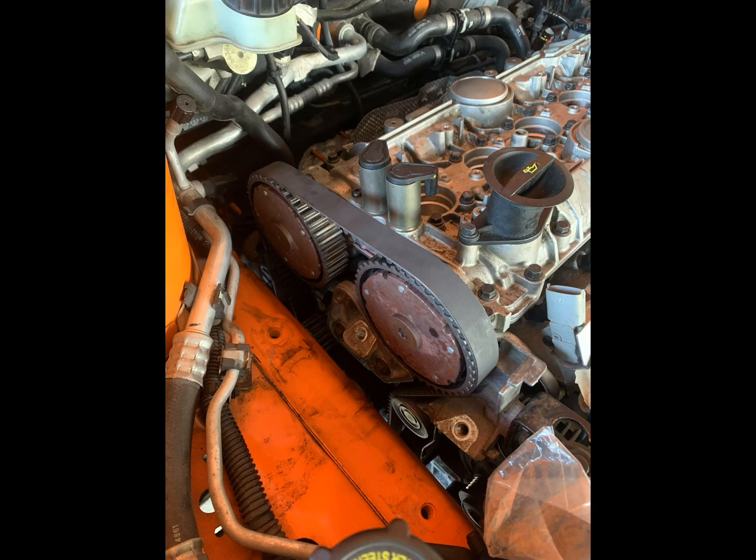I found it quite tricky installing the new cam belt. I suggest watching a proper video on that, and I've linked one in the description below. What you want to do is put it on your crankshaft first. Then keep tension on the right hand side, going all the way up over the idler pulley, the intake cam, and then over the exhaust cam. Then I zip tied it onto the exhaust cam to keep tension, and then went down underneath the car and looped it over the water pump and the tensioner. It took me over an hour to install this. I don't know if that's bad or whatnot. I think it is, but yeah, it was quite difficult. But just stick with it, because this is sort of the last part of the job.